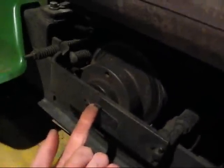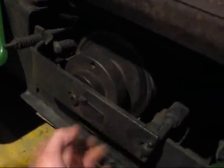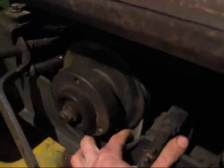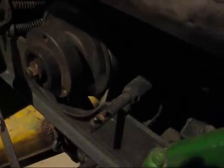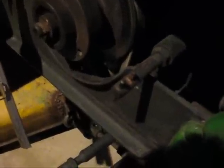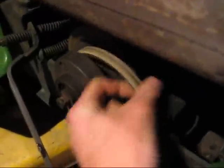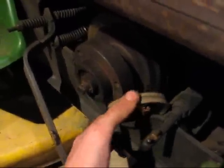And here's the belt clutch. To remove the belt, you flip this up. I've got to loosen up the tensioner — and there we go. The belt just comes right off. I push it down through here, off of the idler pulleys. There's my mule drive pulleys up under there — and that's just that. The belt's off.